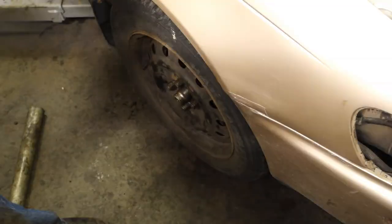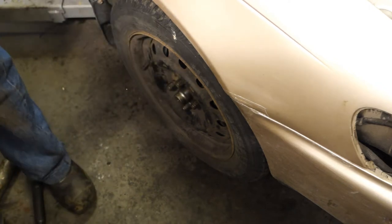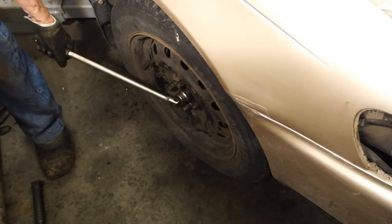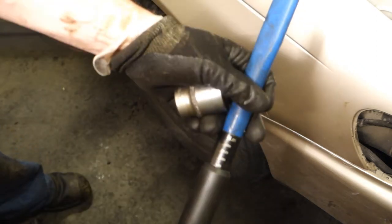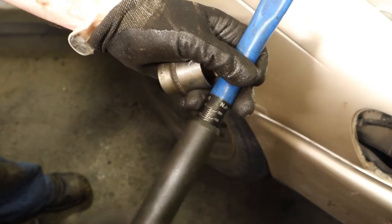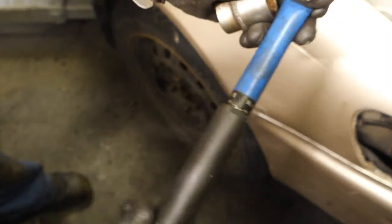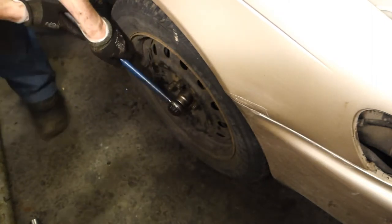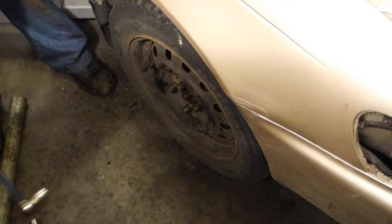And then we continue. Okay, and then we need to fasten this central bolt in here very tight, and this amount is like 200 newton meters, because it is a very tight amount. And next I take my torque wrench tool, and I set up in here the amount, which is 200 newton meters, and I rotate that, and this is a big force for the central nut. I think this is the tightest nut in a car. And now there's 200.